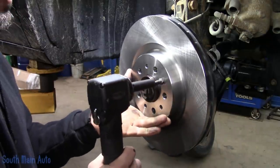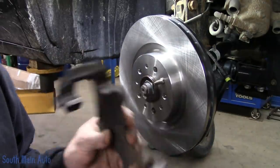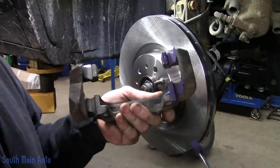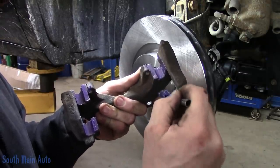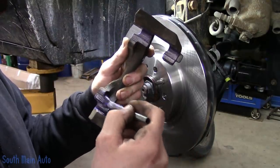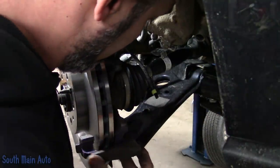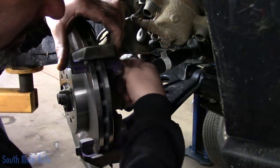Torque setting one, just like so. I've cleaned our caliper bracket — got all the rust and gobbledygook out of the ends. We'll give it a little bit of caliper grease, hopefully to slow down its rusting. Now this style bracket typically does not seize the pads; it's actually a great bracket to have in the northeast or wherever salt is used. However, they did wear very unevenly on this vehicle as you saw — almost 50K on her, but that's not too bad. First set of brakes. We'll find the bolts, stick this back up on here, and torque that down to factory specs.